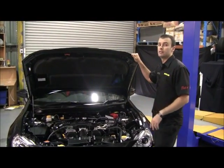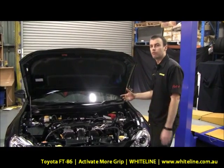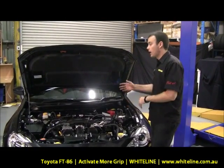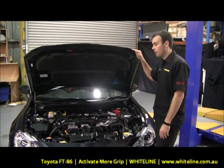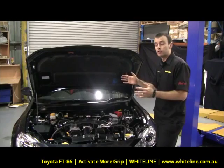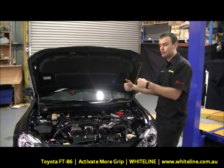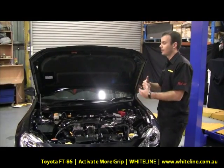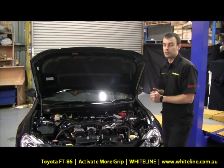With the release of the Toyota FT86, one inquiry we've been getting is how people can get more camber in the front end of the car. We put the car on the wheel alignment, and found the factory had set it to basically zero camber. The one way they'd made the car feel more agile is by setting a little more toe out. That makes everyone feel excited about the handling, but once you push it to the limit, the car really starts to roll over itself in the front end — and that's basically understeer.